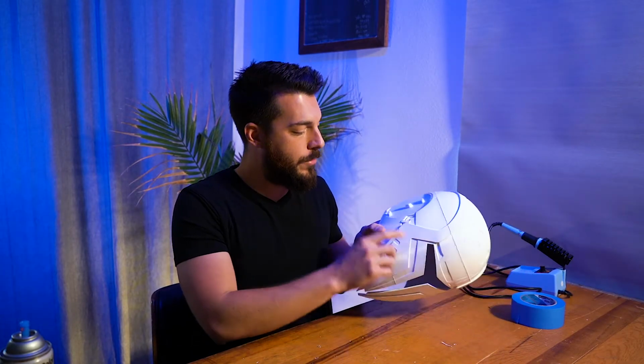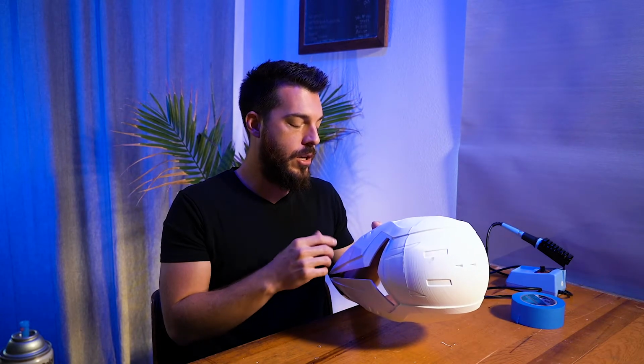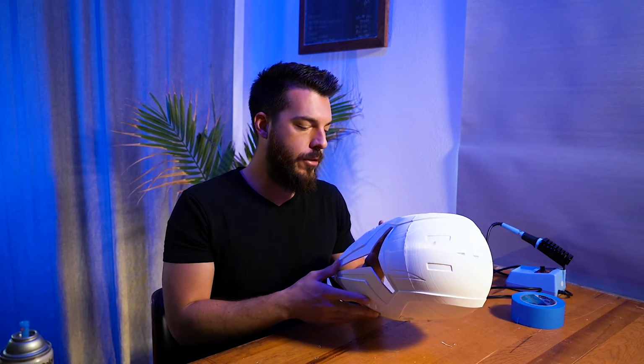And you'll still have to go back and do some more glazing and all of that, but at that point you'll be pretty close. And what's really nice about the filler primer is when it comes to details like this, where it's really hard to get glazing and spot putty in there, it'll take care of most of the striation for you. And then you can go in and use sanding needles or whatever to clean things up.